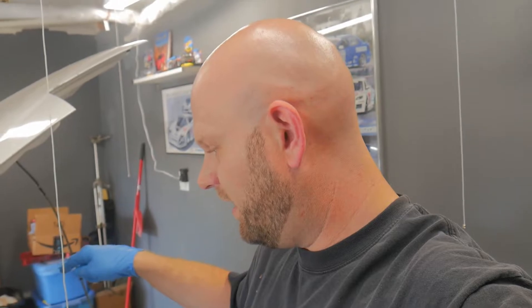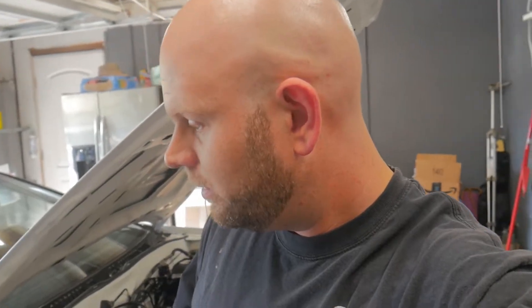I actually have a new, better quality exhaust gasket in a box right over here, so we're going to grab that. It does mean pulling the fittings for the turbo and getting that on there. Then we've got to figure out what to do with that two-bolt. The good news is that's after the wideband sensor, so it shouldn't cause any problems with tuning if we can't get it completely buttoned up.